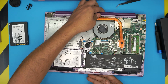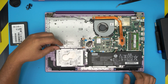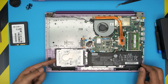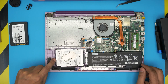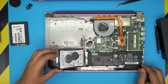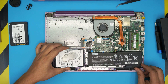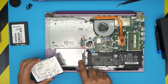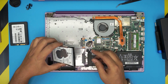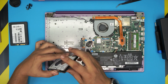Now you'll see the mechanical hard drive right in front of you. To remove it there are no screws — just push the connector jack inward a little bit and lift it up. Don't lift it all the way up; bring it to a 45-degree angle and pull it out at that angle, because the jack has a little hinge that rotates.